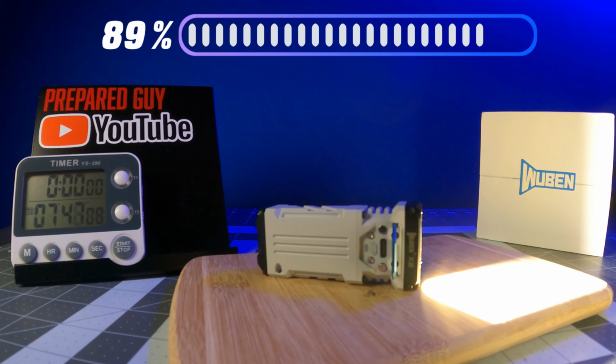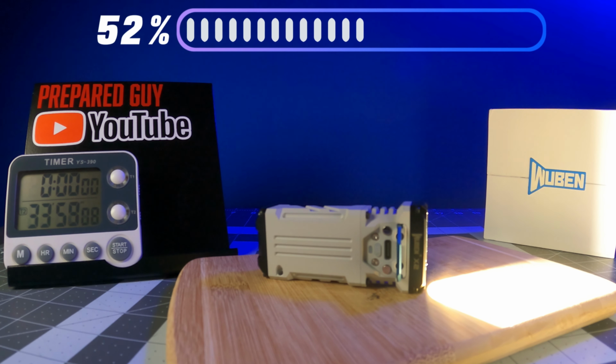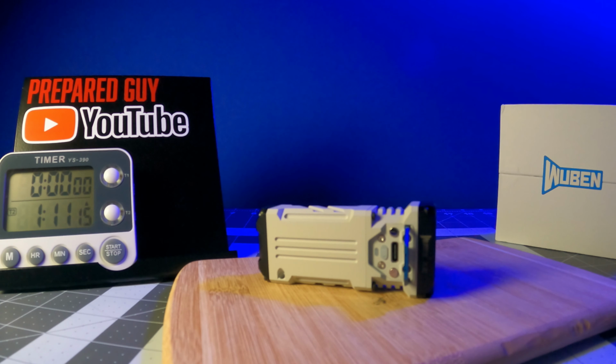During my runtime test in the 2500 lumen turbo mode, the X2 ran for 1 minute before stepping down to the 800 lumen mode, and then stayed at that output until the battery became completely depleted for a total runtime of 1 hour and 10 minutes.